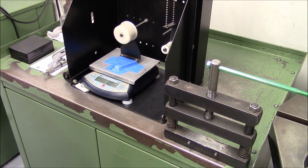What we have here is a rod balancing station. We're going to take these production rods and preliminary balance them so we can determine how much weight we can take out of them. We want to do this before we do the machine work, and after we do the machine work we'll come back and rebalance them to within five tenths of a gram. Right now we just want to get them probably within a gram.